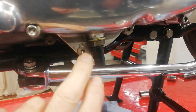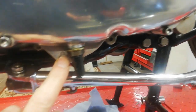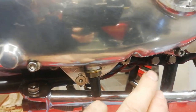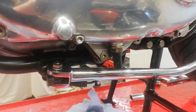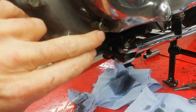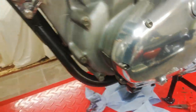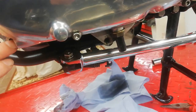Removing all the Allen screws — these are non-original. Making sure I don't forget those two in the middle, and also these two smaller ones down here. Not forgetting all the screws is probably one of the major causes of broken cases — people try to get them off thinking they have removed all the screws when they haven't. I'll take them all out and then double, triple check that every screw is out before removing the case. And even I nearly forgot this other small one just here — get them all out.